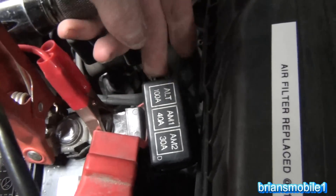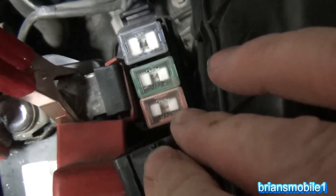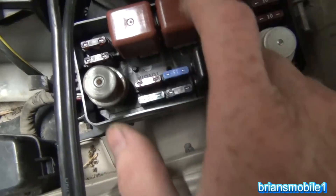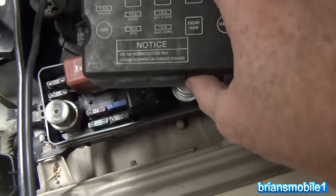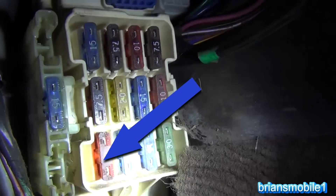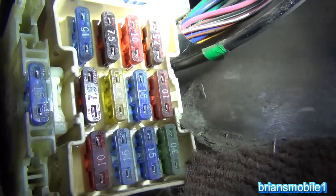You've got your alternator and then these other ones it could be. They're calling this a fusible link and you can see it's just nice and shiny and doing great. There's a couple of fuses you've got to check: a 15 amp one, and then this is the EFI relay - EFI, front heater, something like that. Then the other fuse you've got to check for your fuel pump is this 10 amp fuse right here in the corner - ECU ignition 15 amp, it's the metal one up front. Every single fuse in there is good.